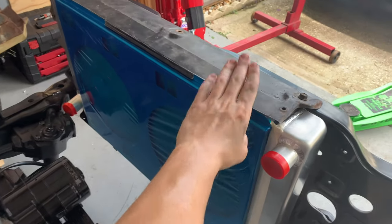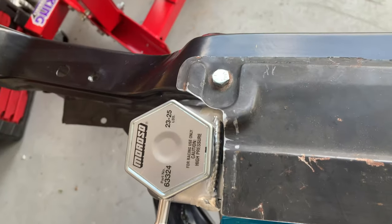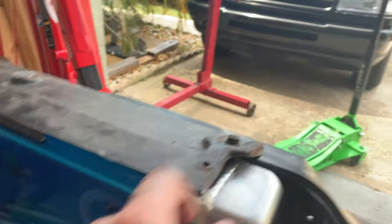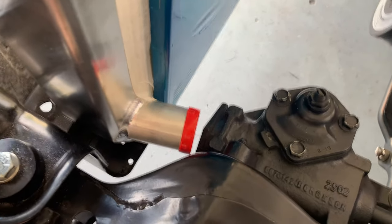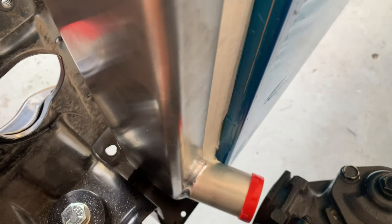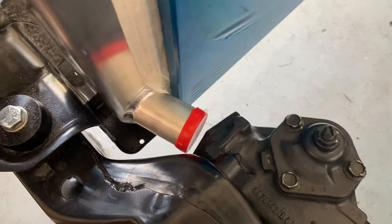Got the new Griffin radiator all mocked up with the factory shroud mount. Went ahead and trimmed it up — there were just some tabs that came off, so it's all trimmed up and looks nice and neat. The shroud is sitting in there right now and this little lip is actually going to retain both the shroud and the radiator. The only thing that's really going to be an issue is this inlet or outlet for the hose. Since this is a universal radiator, it's not going to clear our steering box, but what we can do is cut the neck off past the fan shroud and then use pie cuts or route the tube up, over, or in between the shroud and the steering box.